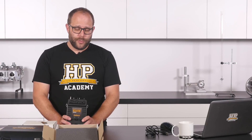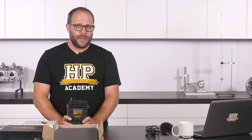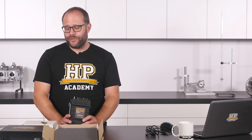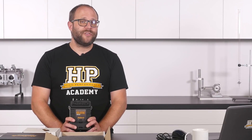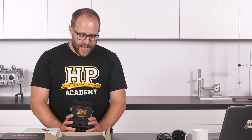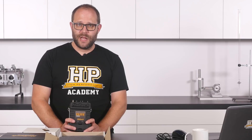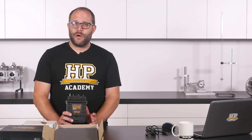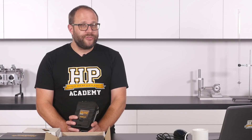A couple of things I would have liked to see in an ECU of this range: a more configurable CAN bus communication side of things, so you could interface it with more aftermarket automotive products. Also an ECU of this calibre should have a built-in wideband controller, however Haltech has provided a solution for that with another product in this box which we'll open shortly. If you're comparing it to Haltech's Platinum series, the Elite is newer and has a much faster processor, allowing Haltech to pack much more functionality into it. The tuning tables are very customisable — you can map fuel in 4D with an overlay table for intake air temp correction, for example. Another key difference is that the Elite series is completely sealed, so you can install it in a marine or off-road application, whereas you can't do that with the Platinum series.